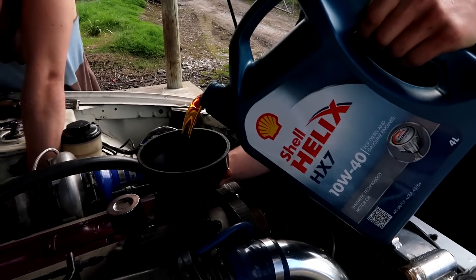We're just holding it at 2k revs to run it in - no leaks this time. Once it's warmed up we can set the timing properly, but it's sounding healthy. Runs smooth, idles by itself. Had a small vacuum leak but we fixed it up with the vacuum line, and water temp got to halfway - all good. We'll check over a few things, dump the oil, change the filter and be ready for a run.